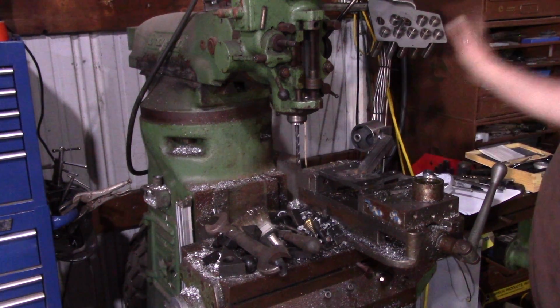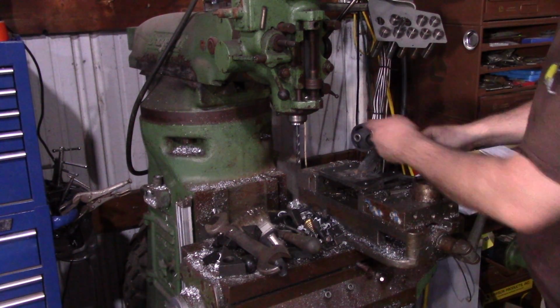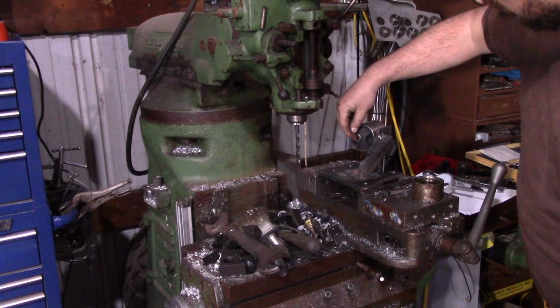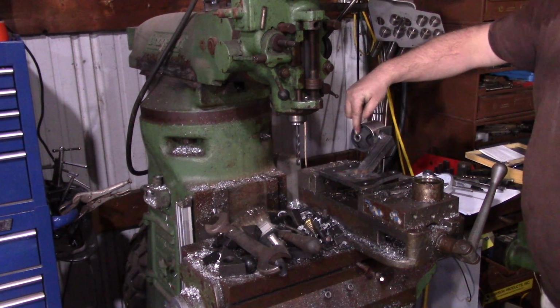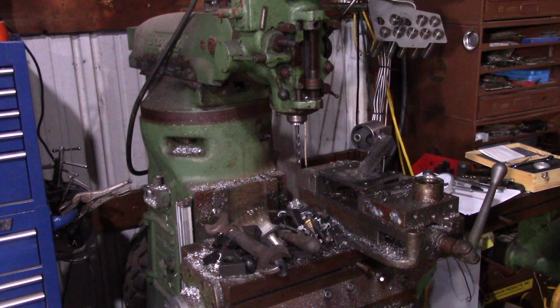All right, so I'm going to pick everything up here. All I need is these 4 holes and this here. Now, this thankfully is centered in here and it's a known diameter, so all I need to do is pick up 1 center point here and 1 center point here, and from that in the computer I can draw the rest.